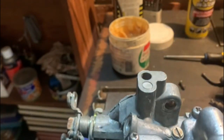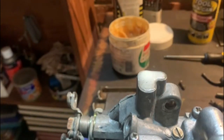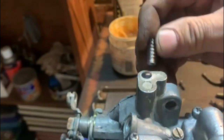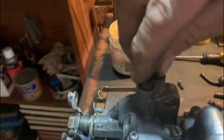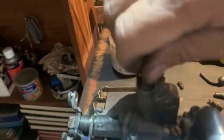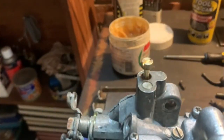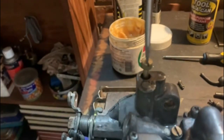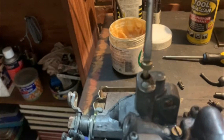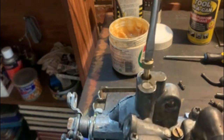And then, very important, put a little lubricant in there and make sure that's perfectly clean. And remember the rusty old spring, that's now very shiny. So, and there we go. Whether that thread is going to make a difference, I can't tell you that. We'll have to test that. And with these things, usually, you turn it in till it seats, and then half, one, one and a half, two, two and a half turns out. And there it should be